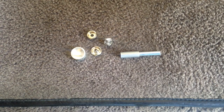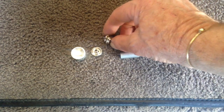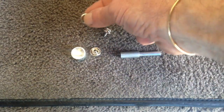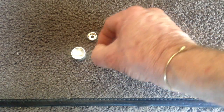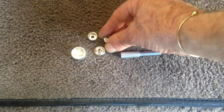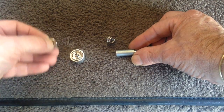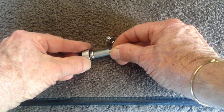To install a snap you need this — the part that's going to snap over the lower part, and its cap. These two parts are sandwiched between the carpet: this part goes on the bottom of the carpet, and this part is visible on top. This other part obviously gets screwed into the floorboard where you want to snap the carpet down. These two other parts are used to create the snap sandwich.